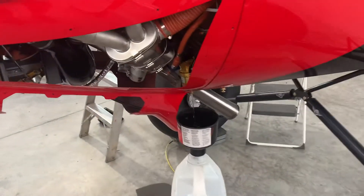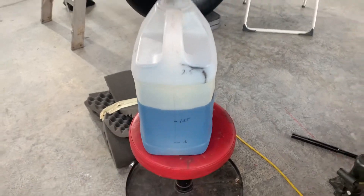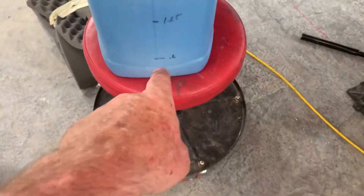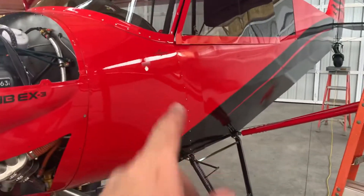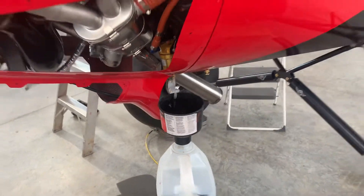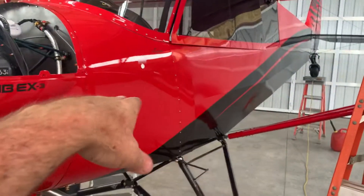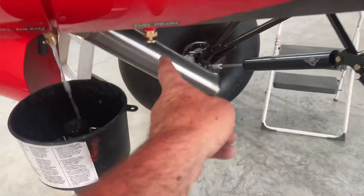You can see the gasolator right here, and fuel is coming out. I've got a drum here marked, so I'm measuring how much fuel is coming out. This is a 2.5-gallon fuel container — I've marked it at 1.25, 2.5, and 0.5. I put 2.5 gallons in each tank with the fuel selector off. Some fuel is going to go down into the drain lines. You can see the left tank just starting to sputter. I've already done the right tank. So with fuel selector off the whole time, you should have fuel available from the drain, but nothing coming out of the gasolator.